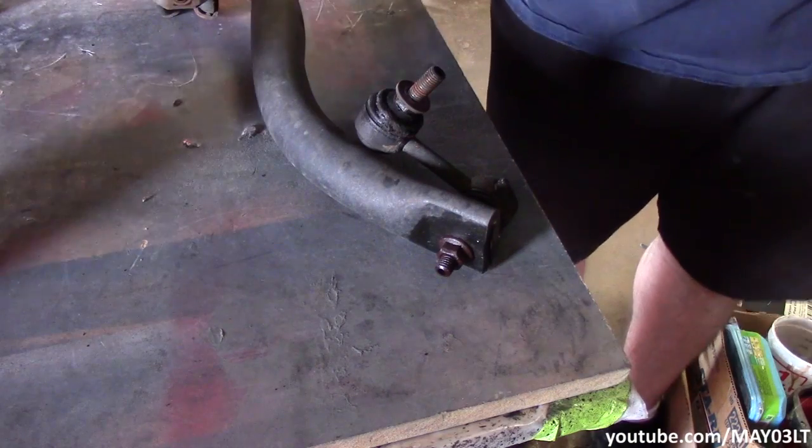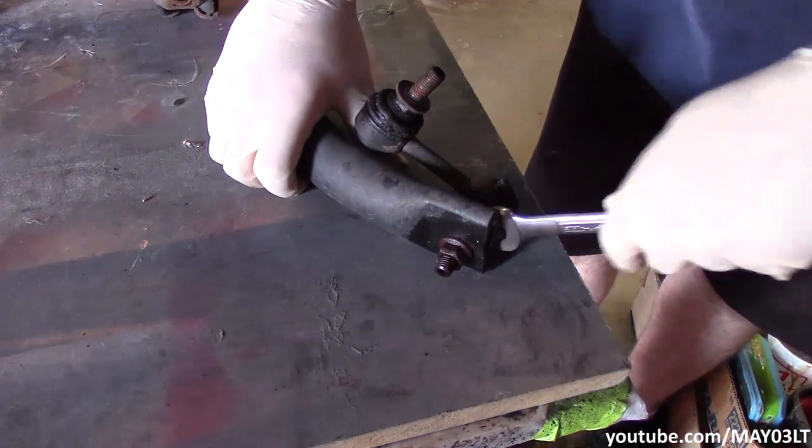While I said earlier that the sway bar links and bushings are usually the number one and number two offenders, right behind them are lower ball joints, you know what I mean? So while I know I've got a ball joint problem, we're going to take care of that later. We're just going to stick with the script of what we were going to do today. We're going to get back on the lift, put the new end links on and new sway bar bushings, and we'll just go from there. Let's go ahead and pop these links off of this sway bar.